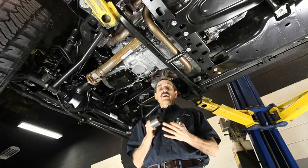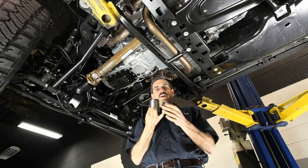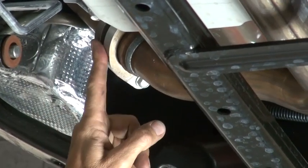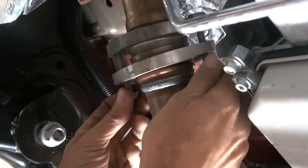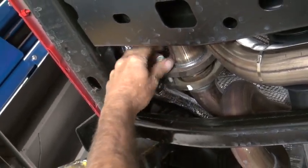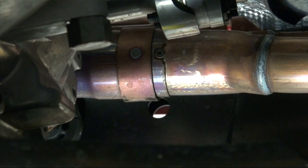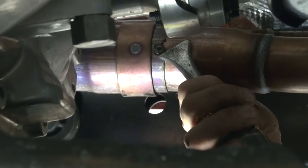Jeep has spent a lot of time on the exhaust systems on these 2012s, and if we change it much we'll affect performance. So we made a couple of exhaust spacers that shift that exhaust back just enough to gain clearance on the driveline without affecting performance. There are two spacers — one slightly longer than the other. The longer one goes on the passenger side and the shorter spacer goes on the driver's side. Use a 13-millimeter to remove the four exhaust flange bolts at the left and right crossover pipe collectors. Loosen the Y pipe clamp where the Y joins the front and rear sections of pipe. Remove the indexing stop — the small spot-welded stop on the intermediate pipe where it clamps into the Y pipe — using an air chisel, hand chisel, or cutoff wheel on a die grinder. This will allow the pipe to slide further into the Y pipe to compensate for the spacers and the repositioning of the crossover pipe.